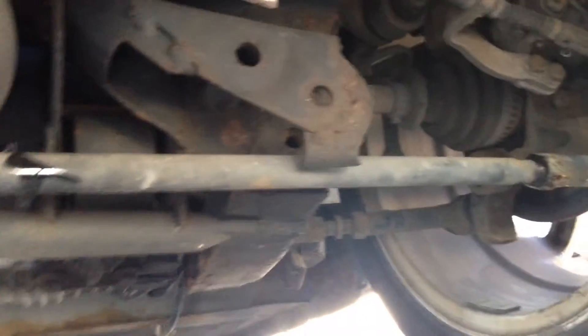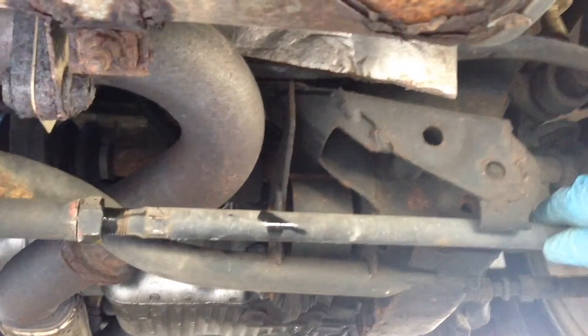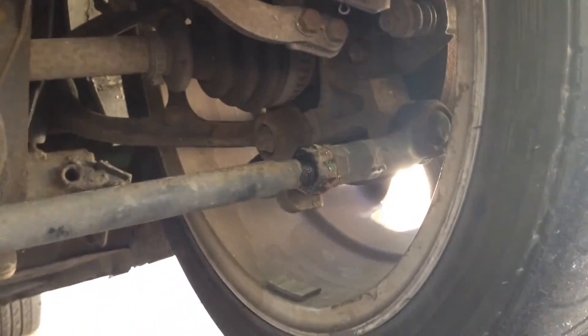You might need to do it a few times. When you're happy with the tracking, just hold the rod tight and do up the lock nuts. That's how to adjust your rear tracking on an MG TF. Similar on lots of other cars, and front tracking is similar as well — just got to find where the adjustment tie bars are. Normally on the front it would be the track rod ends on the steering rack, which will have a similar arrangement. Good luck with doing yours. Thanks for watching.